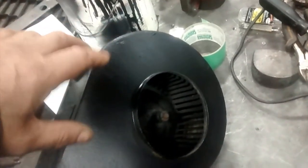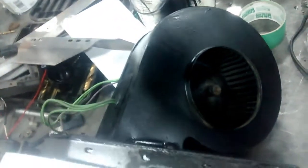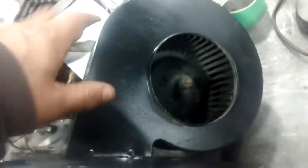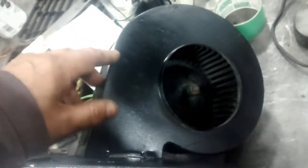So you could use this heater box from a left-hand drive and then theoretically turn the motor from this side to put it on this side. But you've got to change this plastic squirrel cage. And knowing Land Rover, you can't buy them separately. And I've never got one off in all my days without breaking it. They're so tight to get off. So I usually buy a left heater blower motor with this. But when I do right-hand drive conversions, I try to keep as many of the old parts as I can. Now I'm going to show you the difference, why we don't put left-hand drive blowers on,